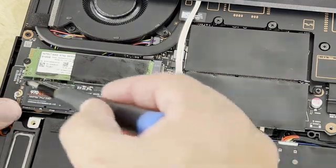When cloning completes, you'll get a menu to power off the machine. Once powered down, remove the USB stick and unplug from power. Flip the machine over, pop the cover off, and remove the original 512 gigabyte drive from slot one. Take the new 2 terabyte drive from slot two and place it into slot one, leaving slot two vacant. Close and secure the case — we won't need to open it again.